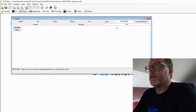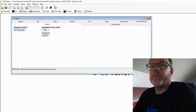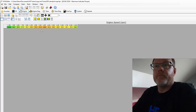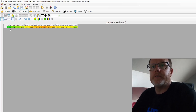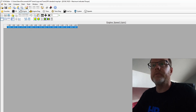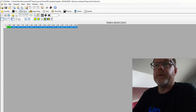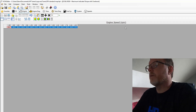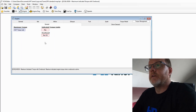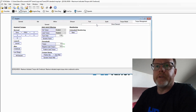That's the torque model. General Monitoring — not going to change any of that, not going to change any of the losses either. Now we come into Torque Management — Indicated Torque Limits. We have to change our Max and Max Over Boost. The torque limits on the car we want to increase by 20 percent — multiply by 1.2. Then Maximum Over Boost — increase that by 20 percent as well.